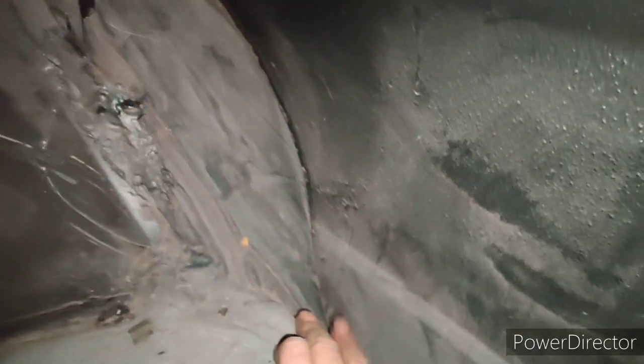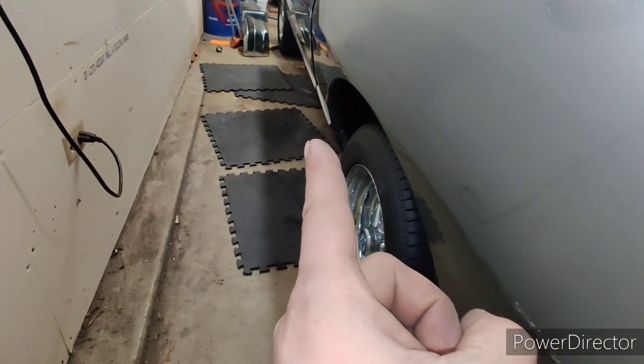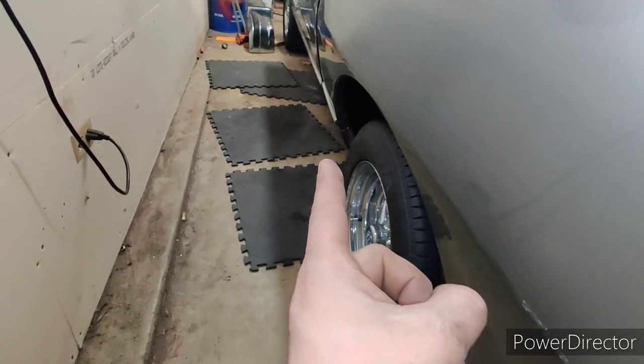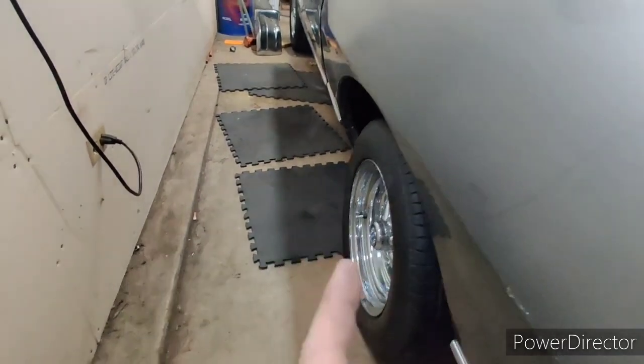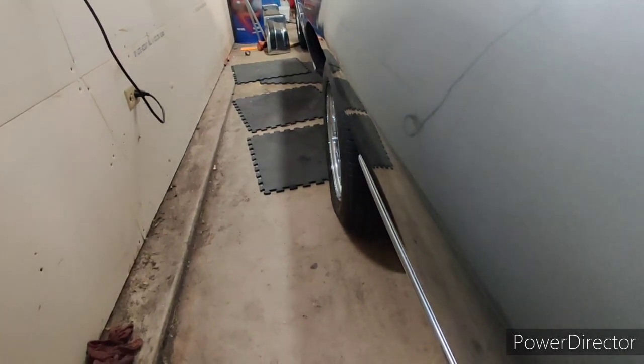You can see in here, this has been buckled, and it doesn't look good compared to this side. You see how smooth that looks? See how tighter everything is? I think when this car was hit, and the idiot who replaced the quarter panel, he overpulled the wheel opening, and he put the quarter panel on, and you can see right now in this reflection how that body molding dips into the door. Well, guess what? Look at how off that is. That's how far out it is down there, so imagine how far it is in the center of the wheel opening, where there is now a difference, right? So you guys can clearly see that, and I hope you can. This is a really good point.